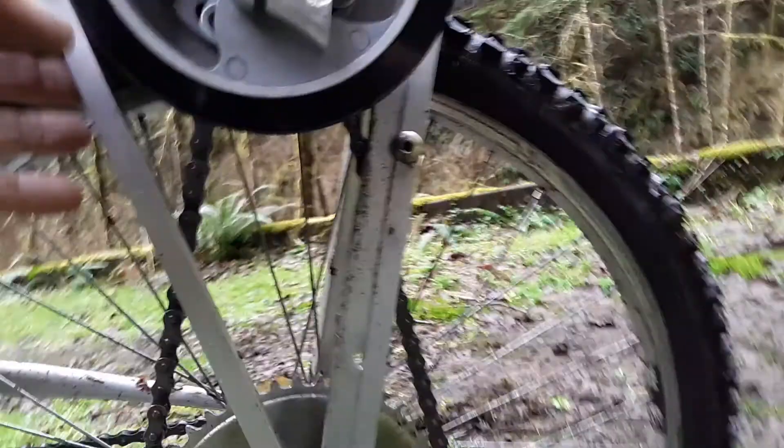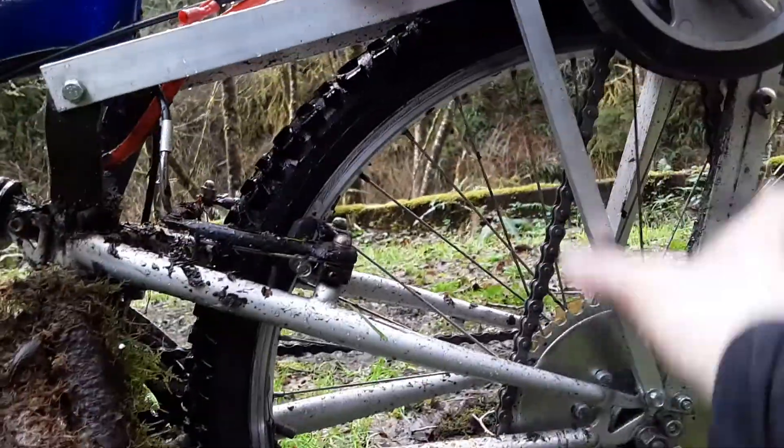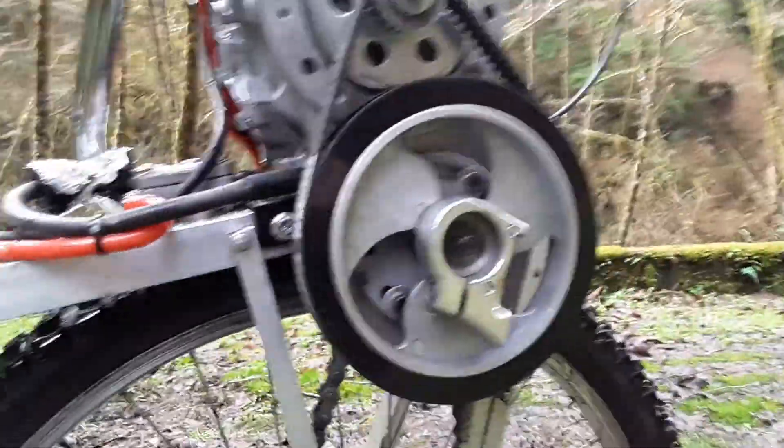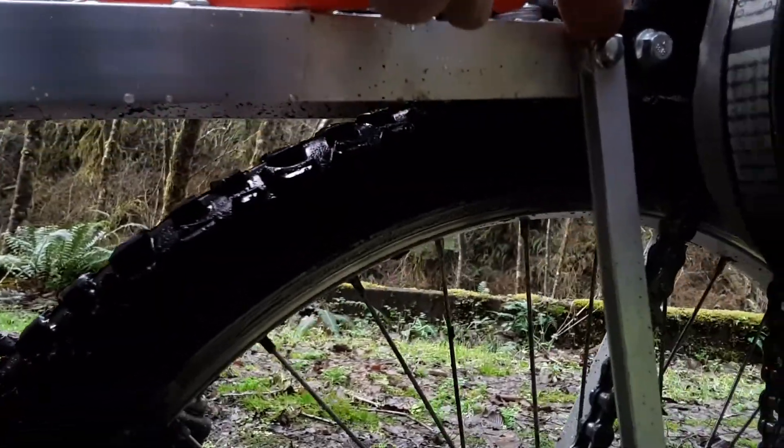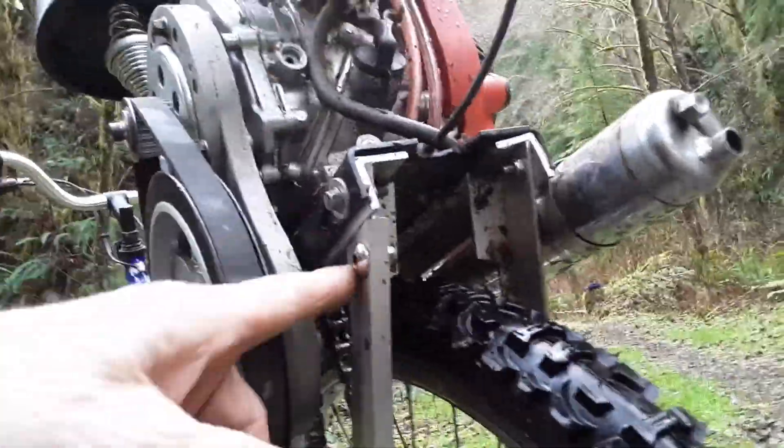I used the angle aluminum as well for these uprights. I used these bolt holes that were already there — I drilled them out. I had to clear the tire, so I had to carve out a little bit there, and I had to clear the chain on that side, so I had to carve out some of that. Because the chain is always pulling down, the strength really had to be in this area, so I triangulated that by putting a piece of channel aluminum — because I want to keep things light. I used this piece of channel aluminum as an upright to give that some strength, because it really only needs to be strong going straight down, and then I backed this one up with a piece of channel and bolted it together. Basically, strong-backed it.